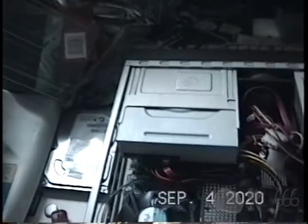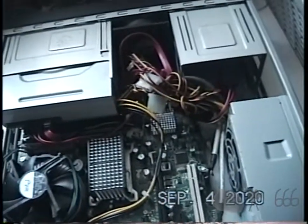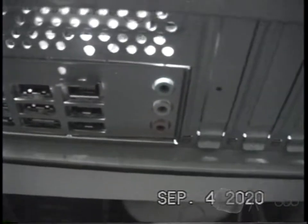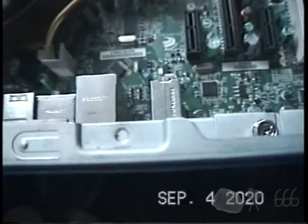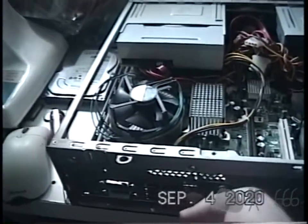I'm going to get this optical drive moved out of the way, get all the cables unplugged, and then we can set to installing the new board, and fixing the I/O shield in the process. Although it might actually be just because the back of this case is bent, because it is fitting in there with no real issue. Well, I am going to have to fix the I/O shield, because I need to fix that little tab that's right there.